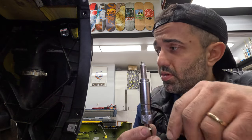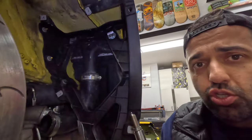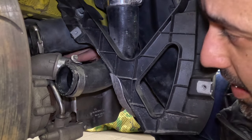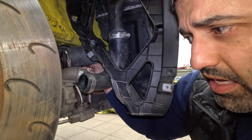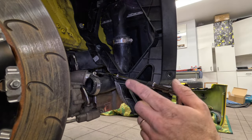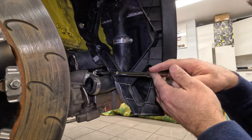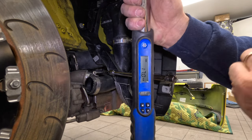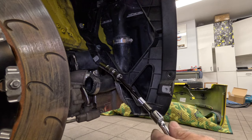This socket is pretty cool — it's magnetic. Inserting the spark plug is extremely difficult to show on camera, but I'm going in from the back, behind the catalytic converter. The trick is to left-thread it first and then tighten it to the right. Removing this pipe from the turbo made all the difference — you can easily go in there with just a slight wobble extension. This allows us to properly torque it; the spec calls for 17 foot-pounds. Make sure the socket comes out cleanly.